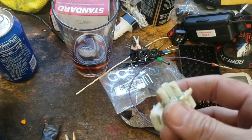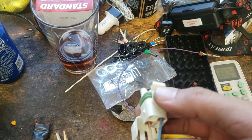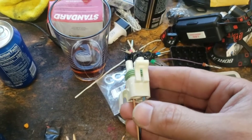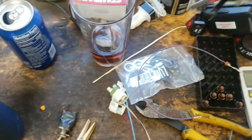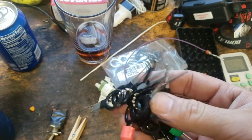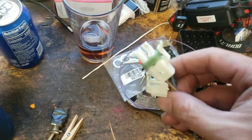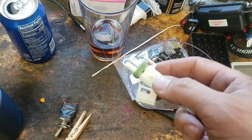After trying to plug this into the transmission, I figured out I had a problem. This pin would not allow it to plug in, so it had to be modified. I took it out, removed the purple wire because that was the one holding me up — it was obvious when you tried to push it in. So I pulled the pin, cut it off, and put the pin back in. Really cool tool — I think it actually came off Wish, like crazy cheap, took two months to get. These little pin pullers go beside the pin and allow you to pull it right out. So easy and so worth it. I'm going to put this back together and try it again — hopefully it will go in this time, and the pin will fall where it needs to fall inside the connection.